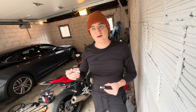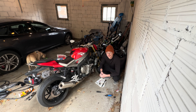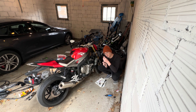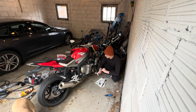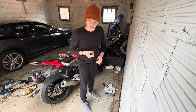I'm going to tighten it up and start it up. As I start it up, I'm going to do some minor tweaks and see if we can get it tuned up a little bit. The manual cam chain tensioner is in there now. I've got this little set of pliers to loosen that outside piece, and then a screwdriver where we can twist it in to extend it and twist it to the left to pull it out. As of right now, it's where the original tensioner was — at that level. Moment of truth.